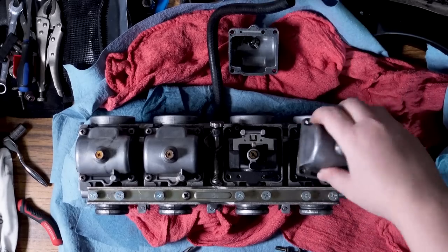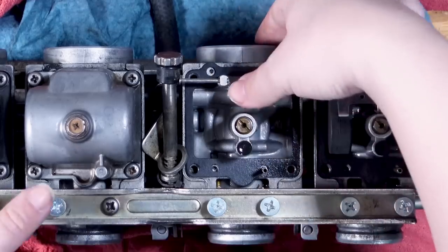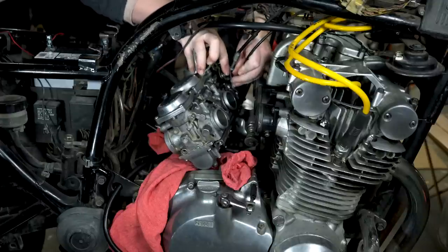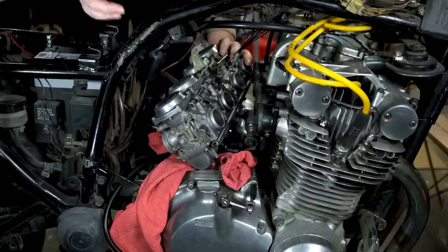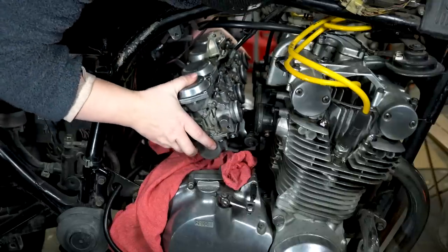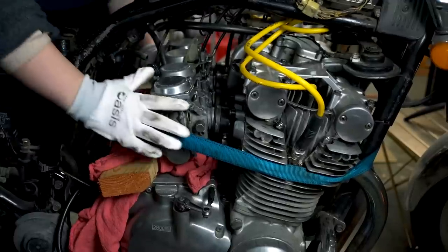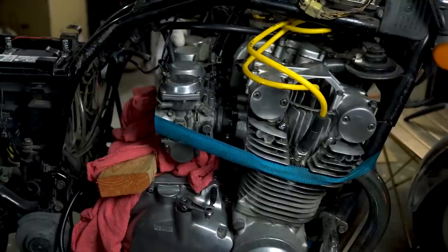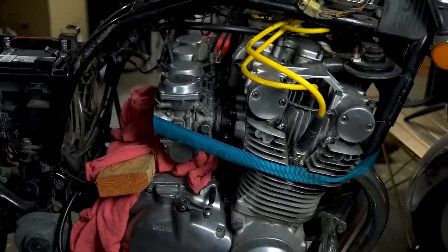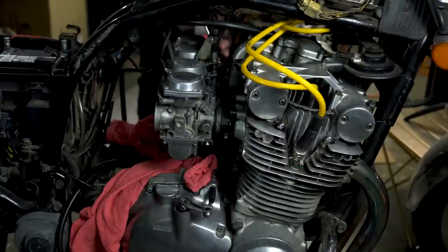But the next day I took the carbs off again, switched out the jet under the float in number three, and put them back on. If you're not familiar with pulling carbs off a 40-year-old motorcycle, pulling them off isn't the big deal — it's putting them back on that's the struggle. Over the years I've worked out my own tricks, like using a ratchet strap to set them on, being careful not to pinch any cables, and only tightening a little bit at a time so I know the carbs are setting in the boots correctly. Now the moment of truth — will she run?